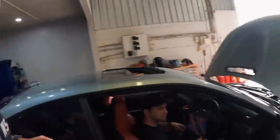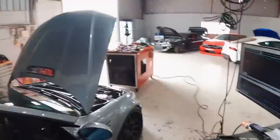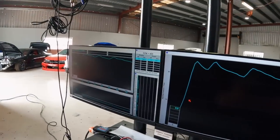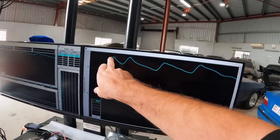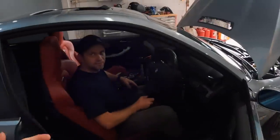That was kind of cool. I filmed it with my iPhone — it's a bit dark in there but you can see the shifts. It's not popping as much as I'd like, but this car does have a proper muffler system and isn't very loud. You can see manifold pressure through each of the four shifts — there is a visible cut and a little puff of smoke, so it is working. It just doesn't sound like a race car, but this car doesn't sound like a race car.